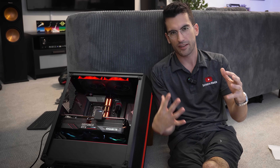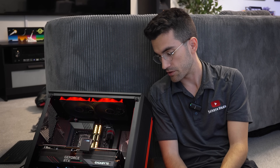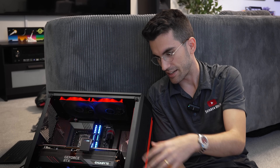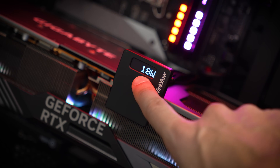I was going to move things to the desk and formalize this episode, but we're just going to keep it rough because we started it rough. What I like to do in situations like this, where I don't really have a clue as to what could be wrong, is remove non-vital stuff. The graphics card doesn't need to be here. There's an SSD and a capture card — I don't think those are the problem either, but we're going to remove all of that and strip things down to just bare platform to see if the same symptom exists.